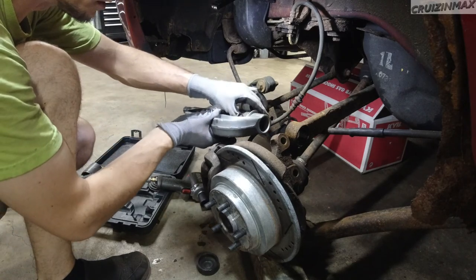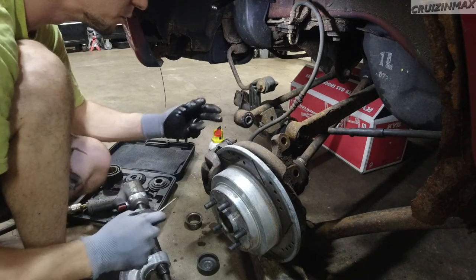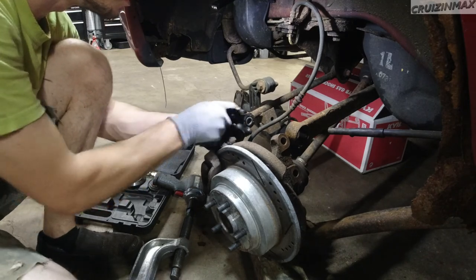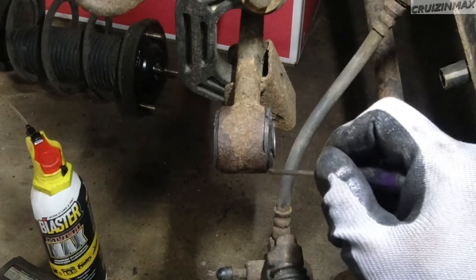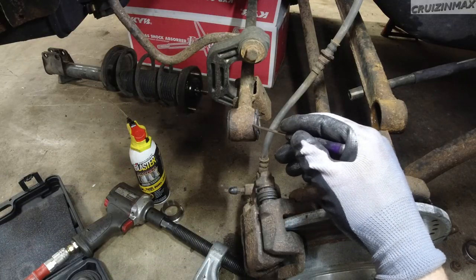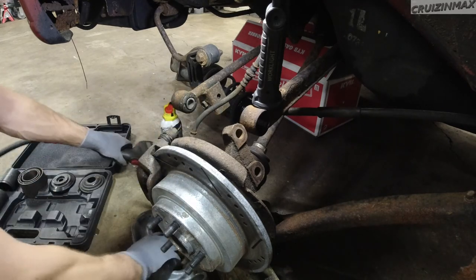Nice, just gonna use that. This is gonna take a while. Should I just forget about it, or drive it in more? So this actually comes out and then drive it back in. Still, man — I think it's the rust. You can see this part has been chewed away, from here to about here. This is the actual width of the control arm, and this is much narrower. You can see how this is kind of a missing part, or maybe it's squeezed and this metal is thicker over here. Okay, rubber's out. But me being me, that metal part is sticking out too far to the right and I just don't like it.